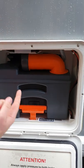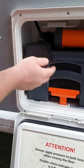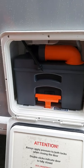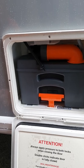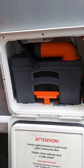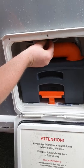Up in here there's a little black tube. That's designed to drain any water out of your filler tank — especially over winter or when you're storing the van for a long time — just stops anything freezing or having the pump submerged in the water for a long period of time. Just pull the little bung out, drain the water, put it back in, and clip it back up into place.